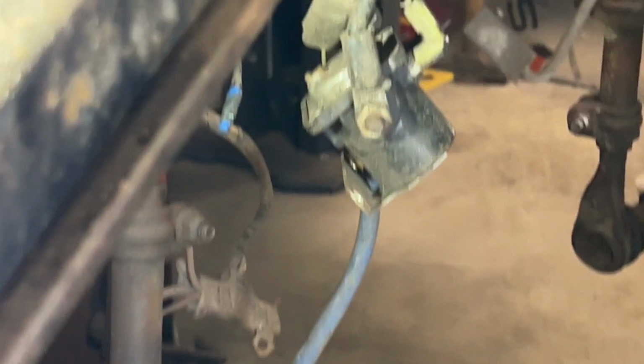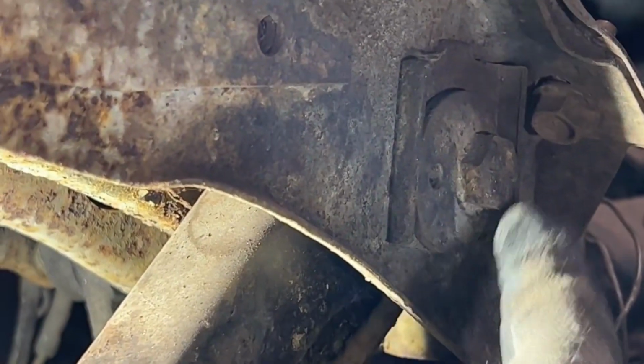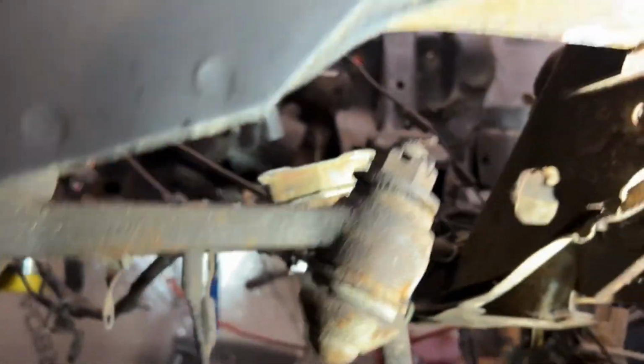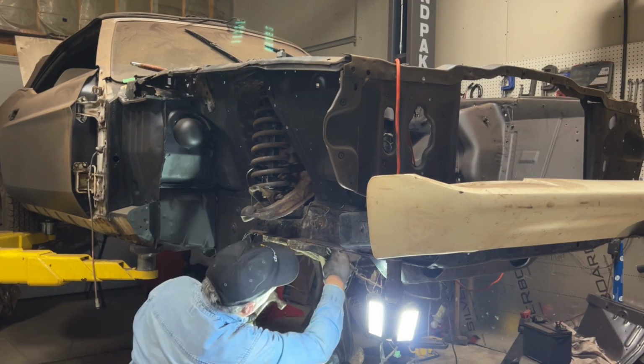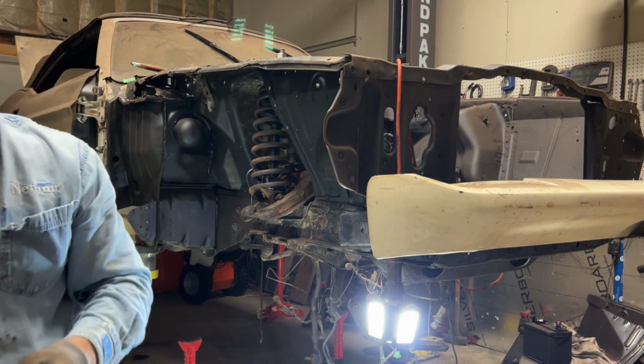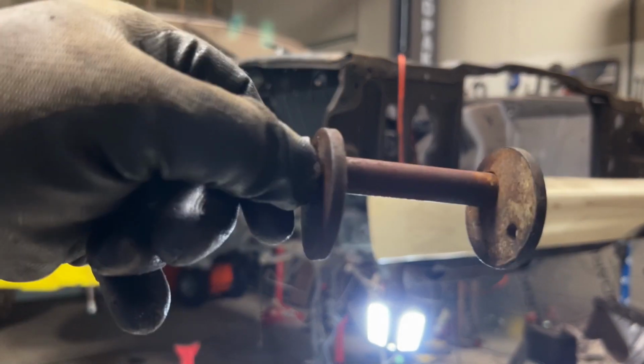And it's basically held on with this bolt. This is a cam bolt. You can see it's, maybe you can't, it's got a big, like it's offset. This washer's offset. That's to allow you to adjust the camber of the wheel. I'll do a video on that when I get to there. So there's a bolt there. And then the nuts. Again, right there. You can see it. And it looks really rusty, but actually not that bad. I've actually cleaned it up. I've actually put penetrating oil and all that wonderful stuff. So you can see this is what it looks like.